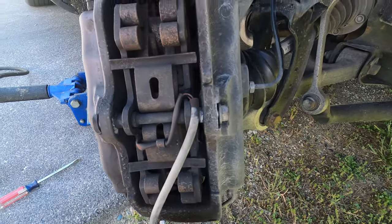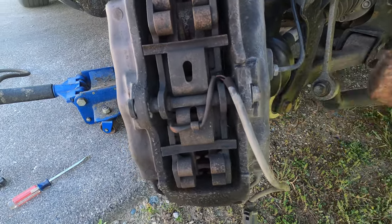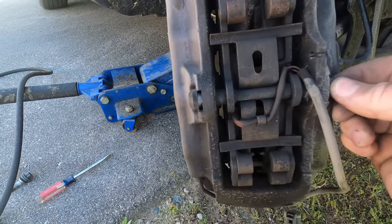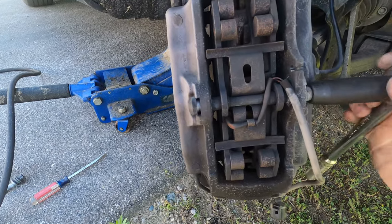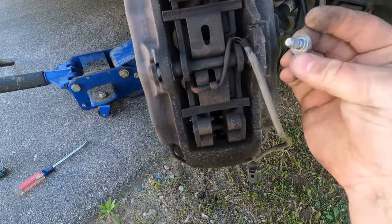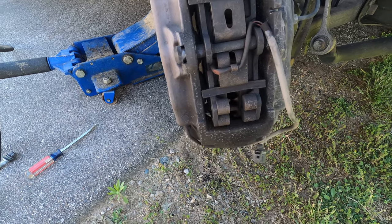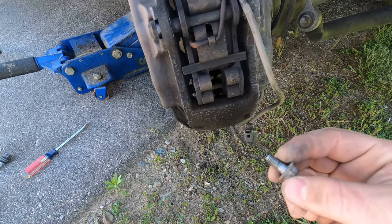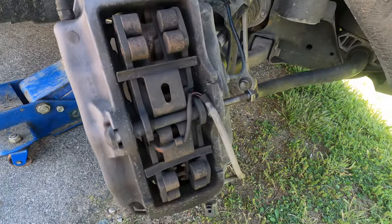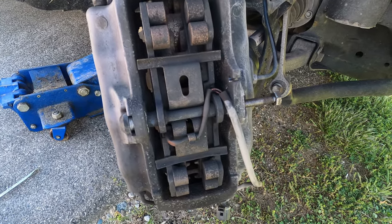Here's that bolt. Loosen it up, get it nice and snug so you have just a tiny bit of a gap — that way more threads are engaged — and then whack it with the hammer and you'll see a gap on the other side. You either get something in here to poke it out, or there's going to be a special tool with these threads on it but no shoulder, so it can pass through and push the pin out without damaging the threads. I had a longer bolt just sitting in the garage, threaded it in as far as I can and I'll just hammer it through.